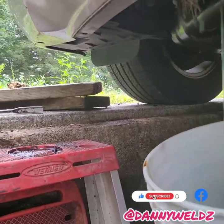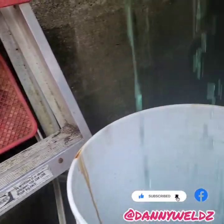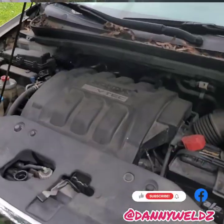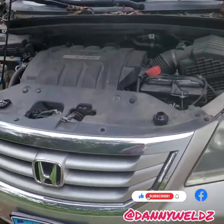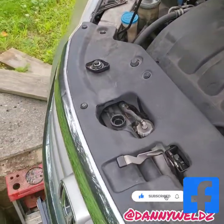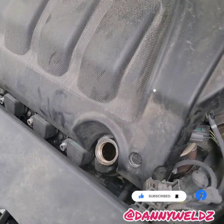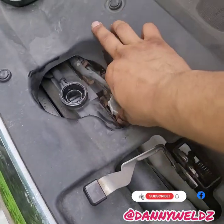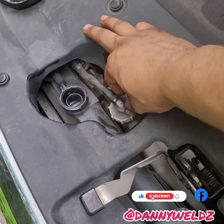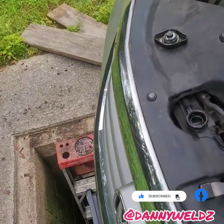Let's catch both. Give that a minute to drain. When you're draining your oil and your coolant, be sure to take off the caps so it releases pressure a little better. That's the oil cap right there, the coolant radiator cap, and this is the overflow reservoir cap. Just take them off to relieve pressure so it flows more freely and a little faster.